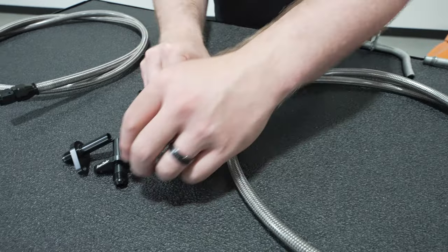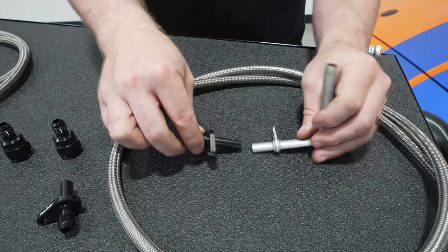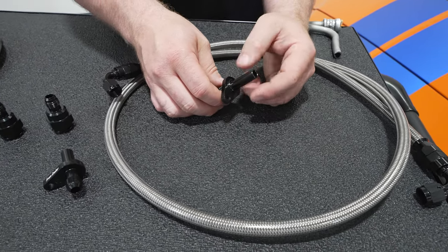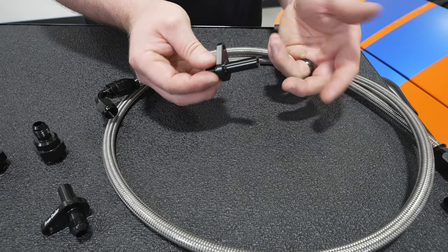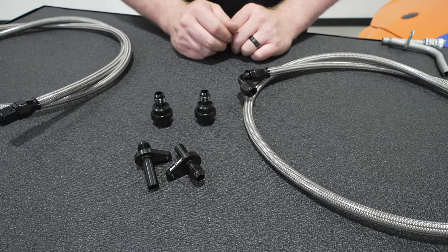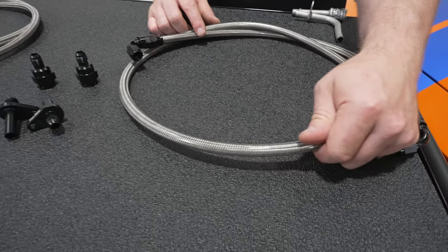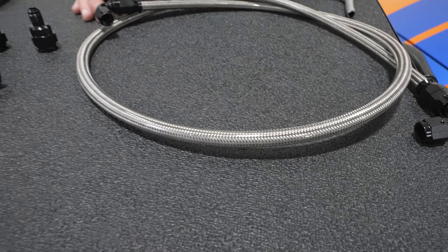These would be your cooler fittings, and the fittings that go up into the transmission are obviously very similar in design. The thing you're not going to get is the deflection issue with these because they're billet. So you'll be able to reuse the factory seals — you don't have to worry about them getting crooked when you tighten the bolt down, they'll be perfectly straight. A single fitting adapts right over to the dash six line. It takes care of all the problems as far as the leaking issues and the factory line downsides. It's a vinyl covered hose so it's not rough, it's nice to route, it won't scratch anything — very clean appearing and they work very well.